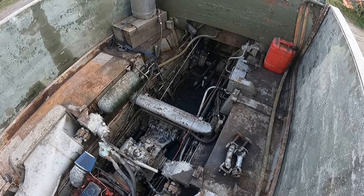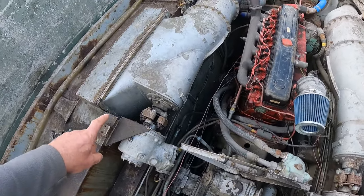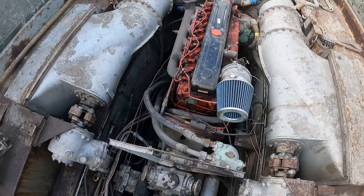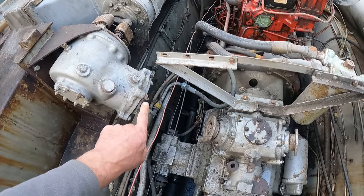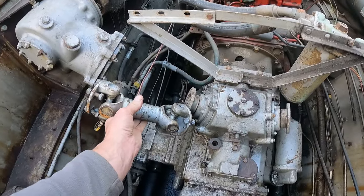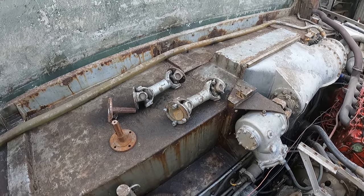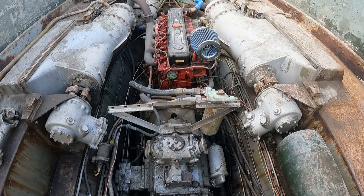All the lower hull is actually in very good condition, which is good news. We do still need a few bungs and then there's the swimming gear. The main thrusters and propellers are all in place — water comes in, the drive shaft spins the propeller in the tube, and pushes it through the nozzle at the back, on both sides. What we were missing was the linkage from the gearbox to the steering bevel boxes for the thrusters. Luckily, I managed to get hold of a couple of the prop shafts needed — they're quite rare — so we're pretty much ready to swim. Let's crack on.